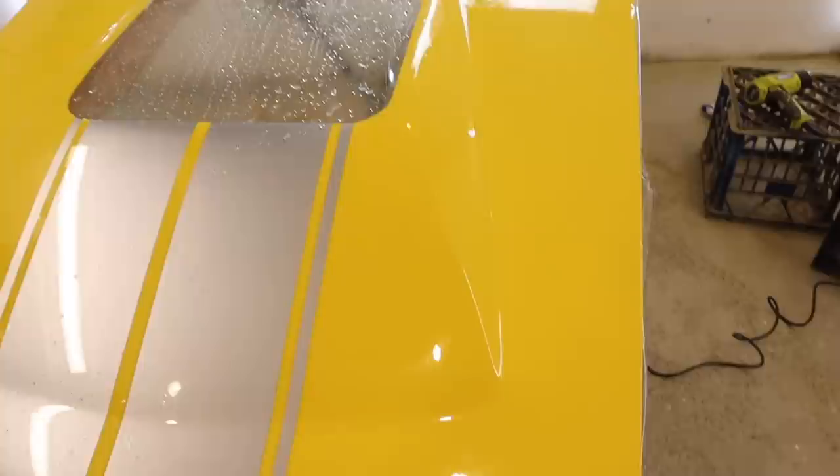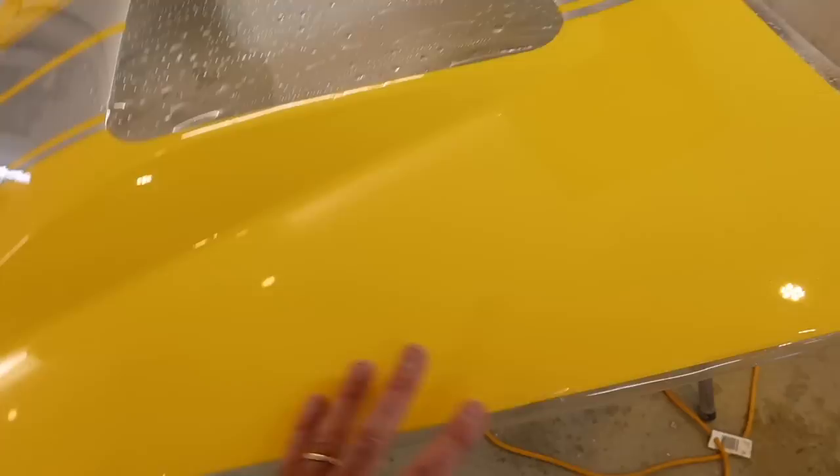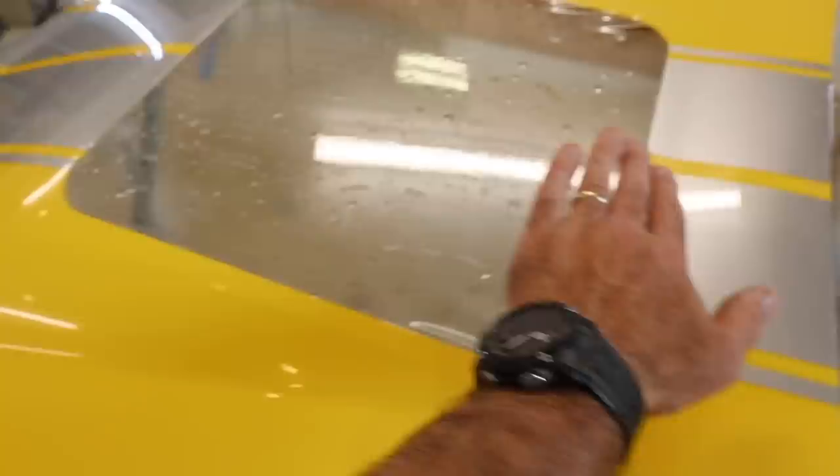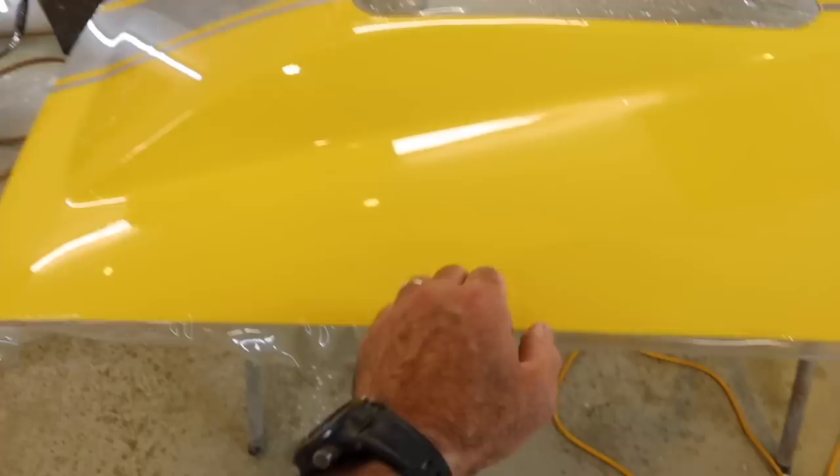So this second side of the bonnet I did is not perfect, but pretty good, probably good enough. I learned a lot. Basically, you need to stretch out the material. I had to stretch it top and bottom because that is a longer curve than this flat is, and obviously then there's a little bunch up on this edge. So I could stretch it out there, but then stretching it out in the middle here also helped, and it actually worked quite well doing it that way.